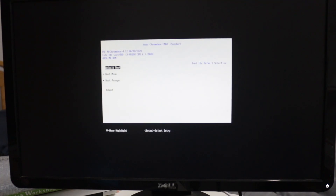Alright, now we're ready to boot and install macOS. Shut down your Chromebox, and when you turn it back on, press the Escape button to enter the BIOS. Use your arrow keys to navigate down to boot menu, then press Enter and use your arrow keys to boot off of your USB stick. When you reach a menu, boot off of the first option. You'll see a bunch of text rolling on the screen, and then you should boot into macOS Recovery.